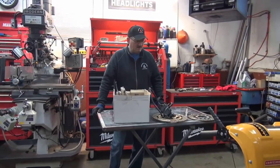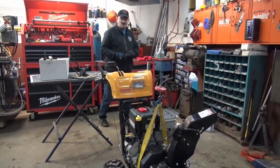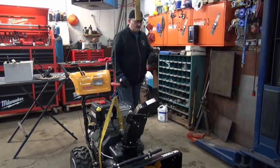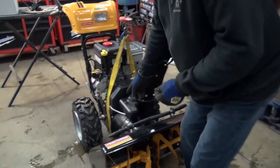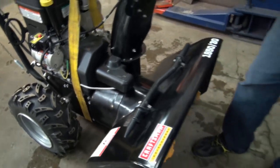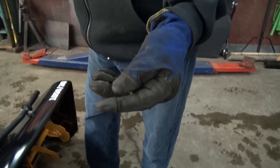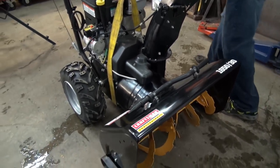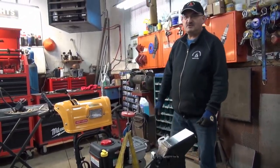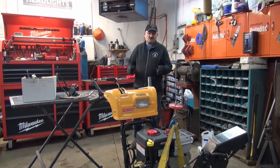The snowblower is done. Mm-hmm. That created a little bit of trouble because these things are put together by young kids in the stores. And if the bolts aren't put on tight enough, or they're put on too tight, they crack. And the heads crack off. Like down in here, you'll see an odd bolt. That's because the top of the head cracked off, and I had to drill out the bolt to get it out of the thing, right? So put it in there. And then there were ground wires hanging off it. They weren't even tight. And the gear shifts weren't working properly. It had a lot of loose levers. Oh, it was brutal. And, you know, no hours on it, you can see, eh? But it works perfectly now.